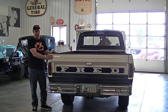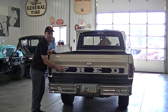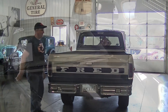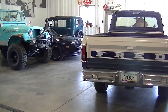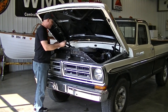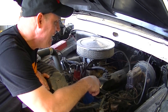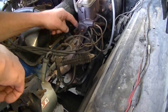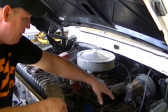Here we are at WMS. We're taking a look at this truck for the first time, and what's interesting — I thought this was just paint. This is not paint. This is actually stamped. I'm thinking that wasn't cheap. And speaking of not cheap, we're going to take a look at the front of this thing and start talking about the Coyote swap. On first inspection, one of the things I noticed right away: the major hurdle is going to be getting that power steering box to work, because this space on the Coyote swap is occupied by headers and the steering shaft. It's going to be a tight one — we're going to use stock Coyote headers, but I see that as being my first major hurdle.